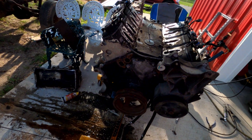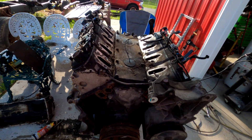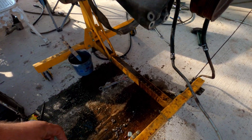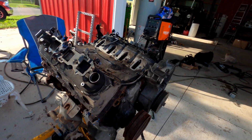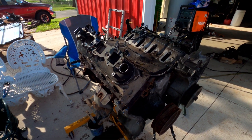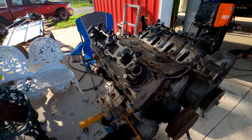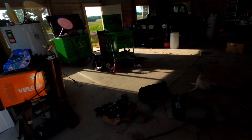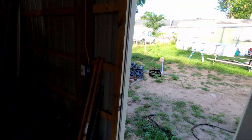Alright ladies and gentlemen, welcome back to The Driveway Engineer. I'm JR. This is the 6-liter I pulled out of the dumpster - it doesn't spin. Today we're going to figure out why. I suspect that's why - that's rusty water that came out when I turned it upside down. I don't know what this dirt is, but that can be bad news bears. I know the crank is good because it'll turn through about 350 degrees of rotation.